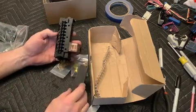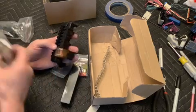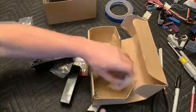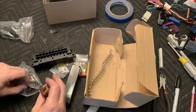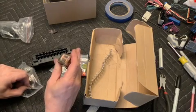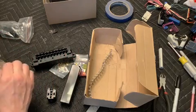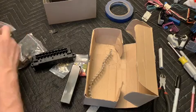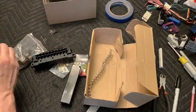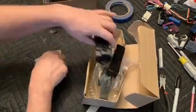So there you have it. That would be a fairly compact system. You'd get all your relays on the outside, have a cover for the fuses, and working off the back, you get to decide what gets ganged with what as far as power supply and sources. And then these relays, I think, were rated at like 100 amps, which the plastic in this system would never handle 5 of those things drawing 100 amps through it, but that's not really the important part. We'd never be looking at more than 35 amps to 40 amps anyway. So that's this system, and then we'll pull out the other one that I've got.